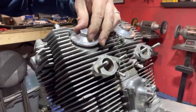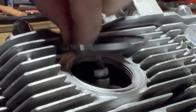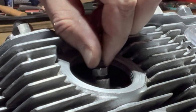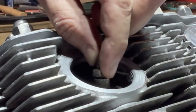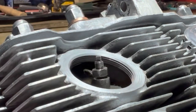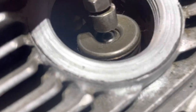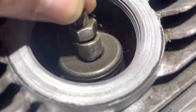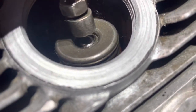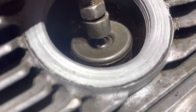Let's take this off — nice shiny covers. This is probably going to be tough to show you, but I'll try to do a zoom in. What we've got here is a little adjuster right here, and a little locking nut right here. This is going to be tricky. I'm going to actually have to cut down my feeler gauge a little bit because it's super narrow. Our adjusting spot is right down in there underneath, and there's a little bit of a concave to it. I'm going to have to cut down my feeler gauge just so I can get in there and adjust that properly.